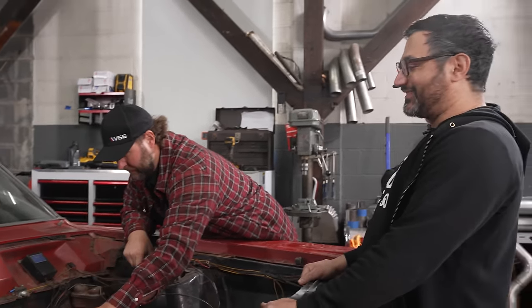Have you ever seen a ladder bar mounted with one bracket? Yeah. I wonder why they're twisted. Could be anybody's best guess. You just hang it out here. It's fine. You can start doing stuff in double shear. Go nuts. Wait, is this the brake line or the nitrous line running right above the drive shaft? That's the brake line. This is before they had bulkhead fittings. I mean, we could get rid of the narrow rear end, probably. You can move these all back where they're supposed to be if you really want to get nuts. Pretty good buy. Pretty solid. I like these quarter-inch nuts holding this cross support. That we're going to fix. Yeah, we're going to weld some metal in there for sure. I don't think I'd put my whole kit and caboodle on those quarter-inch nuts right there.